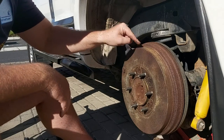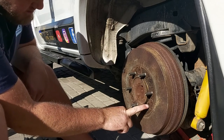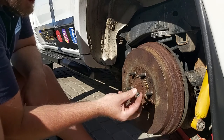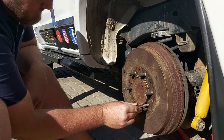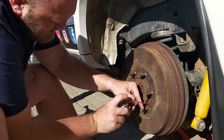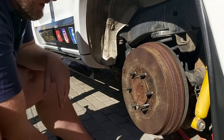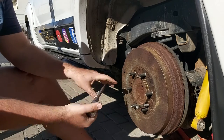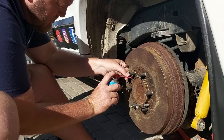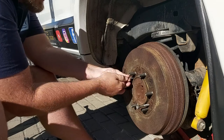What you do is we need to remove the drum from the assembly. You'll notice that here is a hole with thread in it. So what you do is you take your 8mm bolt - I've got a hex nut here but you can use basically any 8mm. And just a slight squeeze of Q20. The other one is on the opposite side, directly opposite. Just a squeeze of Q20. The problem is if you get that Q20 on the discs on the inside, you're going to have problems. So that's why you're just putting enough to wet the area.